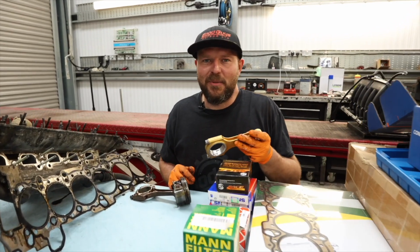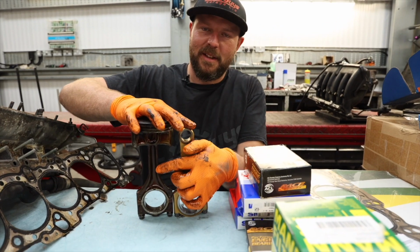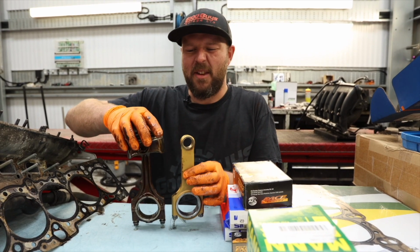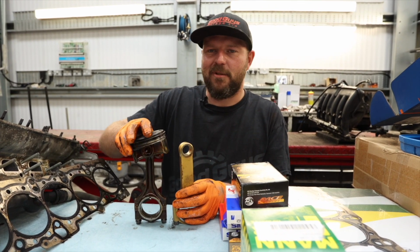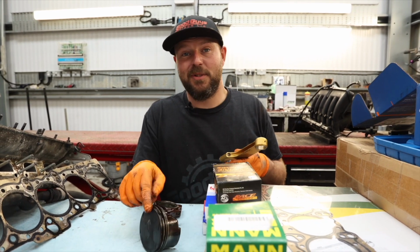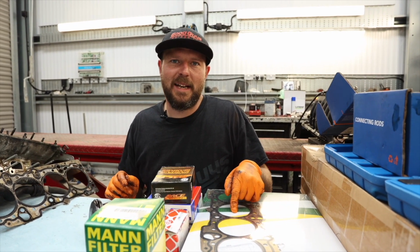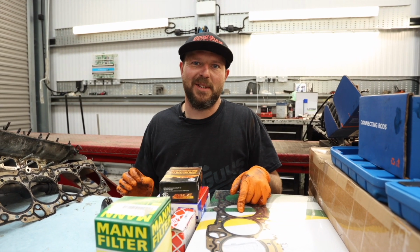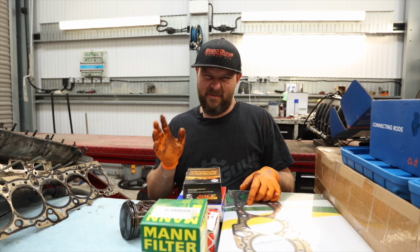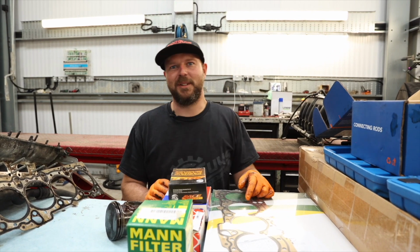The reason why we're going through all of this expense is, if you look at the difference between the connecting rod that's going out and the one that's going in, it's obviously a lot more manful, and they're about the same sort of weight. So we can run a lot more power with proper rods. I'm told that the pistons are fine. We're putting a larger multi-layer steel head gasket on there to lower the compression ratio ever so slightly, so we don't have to worry about the fuel too much. Winning. 450-ish horsepower, certainly over 400. Reliable is what we're after.